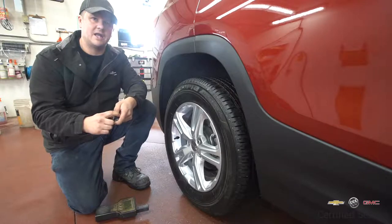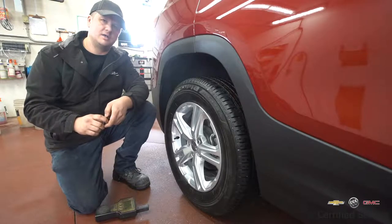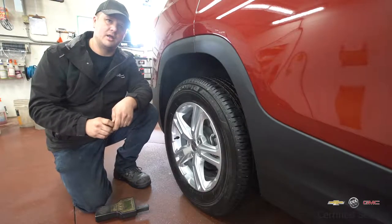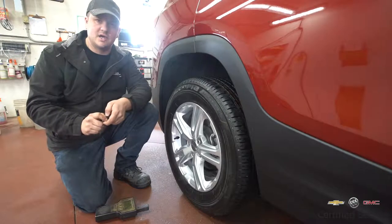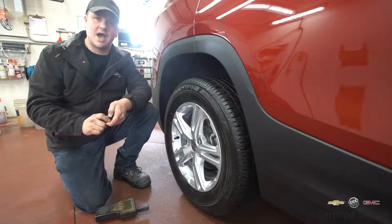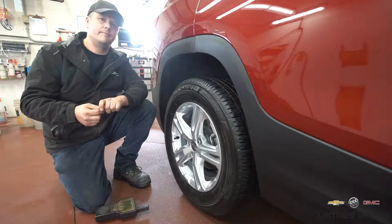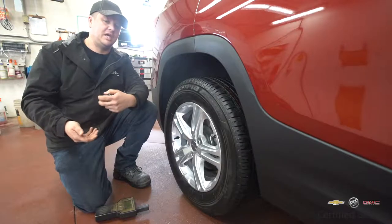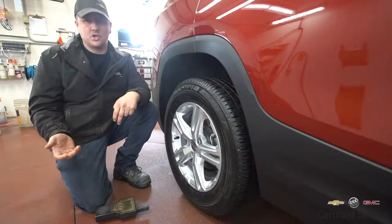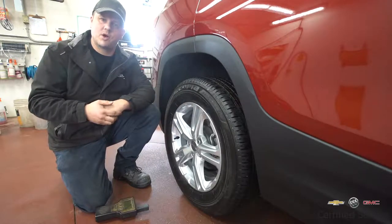Here in Canada, that's displayed as kilopascals normally on your dash. One thing to be aware of: there are just about seven kilopascals per pound of air in a tire. Also, a good rule of thumb is for every 10 degrees of temperature drop, you'll show one pound or seven kilopascals less on your dash. So you can get quite a fluctuation if you're watching the tire pressure monitors on your DIC. Don't be too alarmed if you see a difference of 14 or even 28 kilopascals, or one tire with more pressure than another. Even sunlight directly on the black rubber tire can increase the pressure inside.